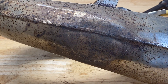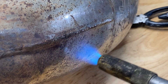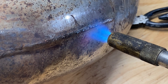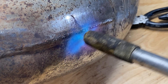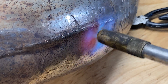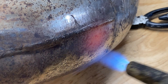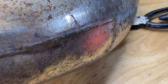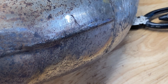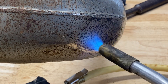What we're doing is heating up the dent until the metal gets soft enough for the compressed air inside the pipe to push it back out — it's kind of like magic. You're watching as I'm heating it and you don't really notice it moving, and then all of a sudden you realize the dent is gone. You can see it moved quite a bit right where that weld is. Pretty cool process.